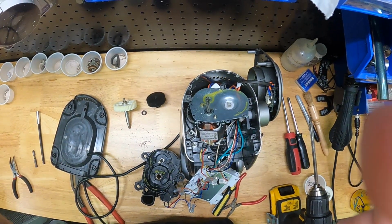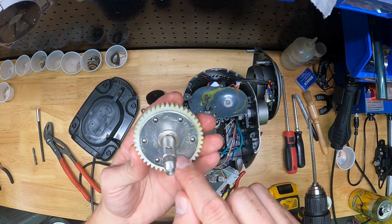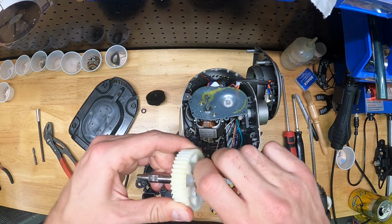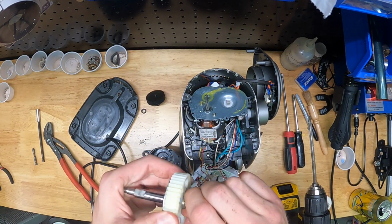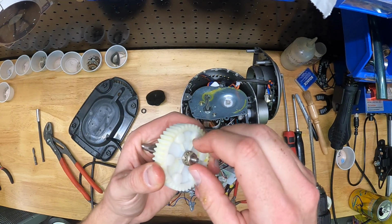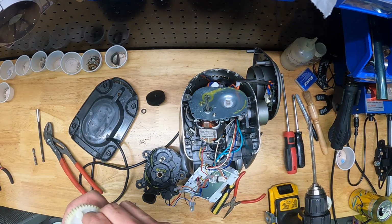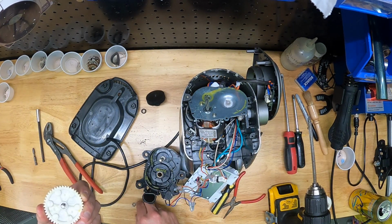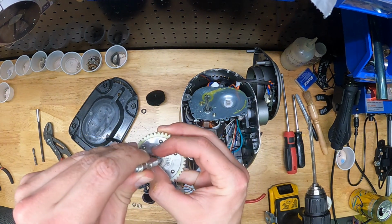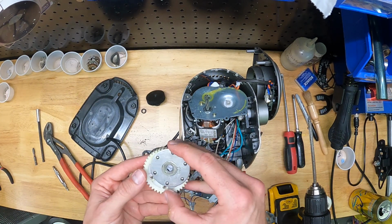And so we're in. Okay, so here's a little aside, I guess. Here's the gear shaft, I don't know what you want to call this thing, but there's a slipper clutch built into it. And this is what's supposed to protect the gearbox in the event of, say, a rock gets into your grinder. This thing is designed to skip, essentially, and slip and not trash your gear teeth. Mine, obviously, and probably yours if you're watching this video, didn't do a good job of protecting those teeth.